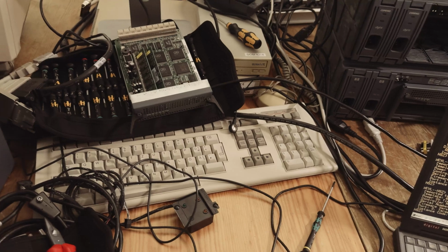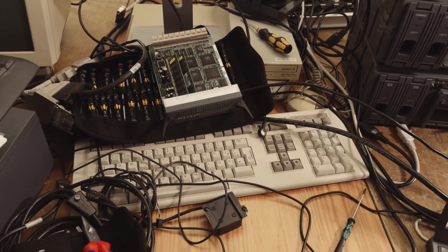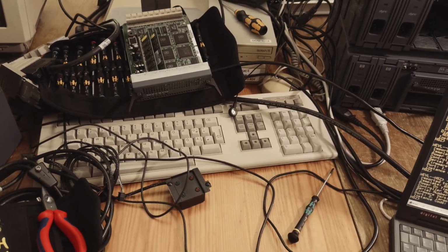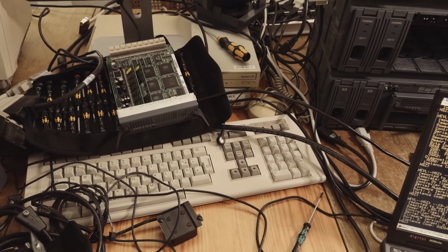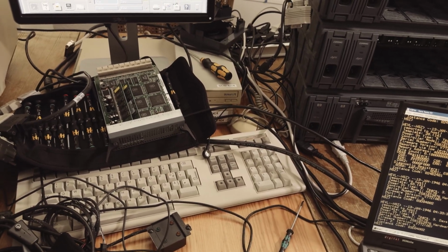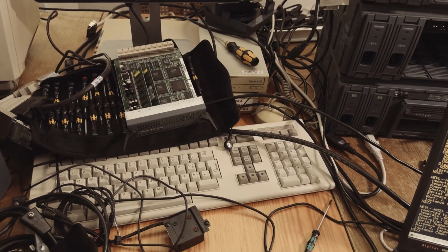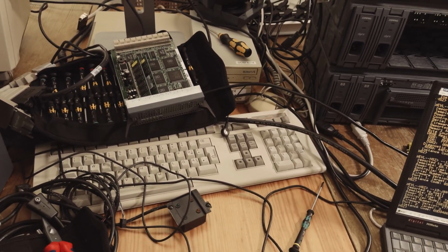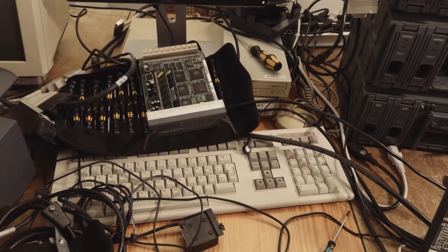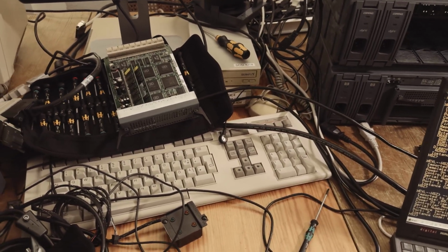When you put that controller in, you only see some kind of Intel NAND utility, because there's an Intel i960 processor in it, but I'm not able to boot from the PCMCIA card where the firmware is located. Therefore only one controller is left, and I have to change the battery in that controller while supplying power to the controller via a PSU or something like that. I'm afraid of breaking this controller as well. But when the battery is totally empty, the controller is also broken. So when I use that controller, I have no chance.